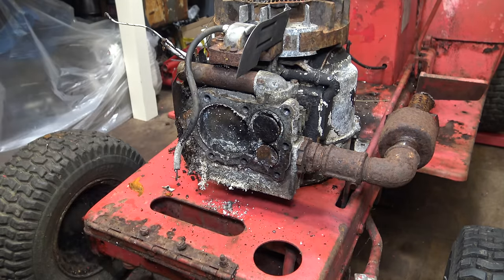We also have the fuel pump, and again I will be changing the diaphragm under here. It does sometimes get stuck. Oh nice. I think that's the worst part yet. Of course, it's the spring. Steel spring. Yeah, that's going to need to be replaced. But it's still cleanable. Right, so let's put it into the ultrasonic cleaner and see what that can do. I think it's mostly just going to loosen the dirt. The majority of the actual cleaning will be with the carburetor cleaner.